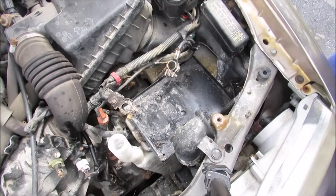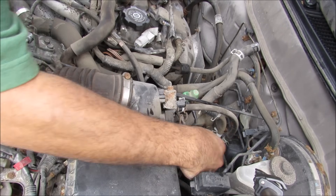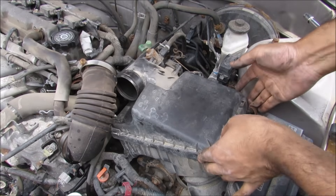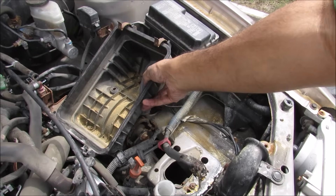I'm going to lift out the battery to get a better view. At the back here I'm going to disconnect some electrical connectors, the mass air flow sensor, as well as the vacuum line over here. Then I can remove the top of the air box and pull out this box.